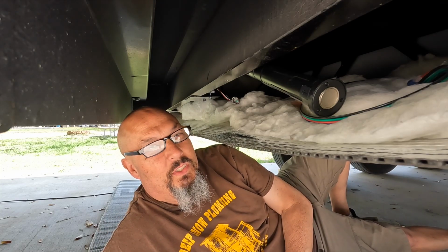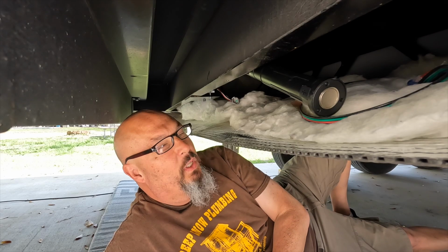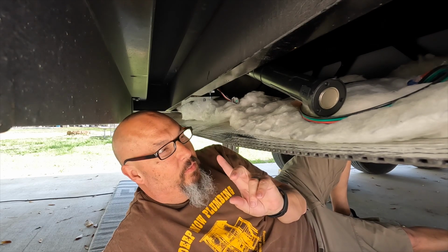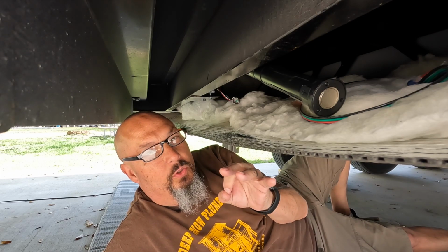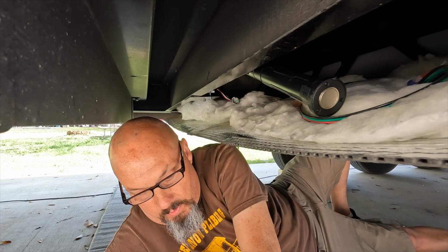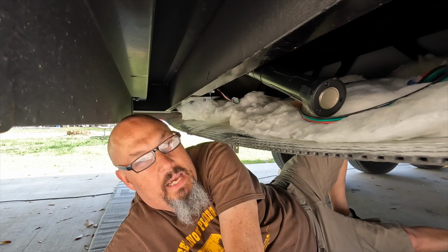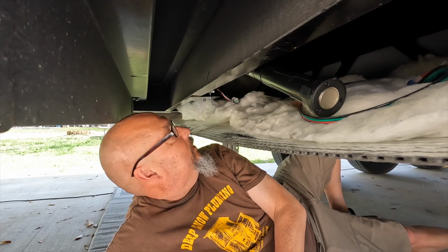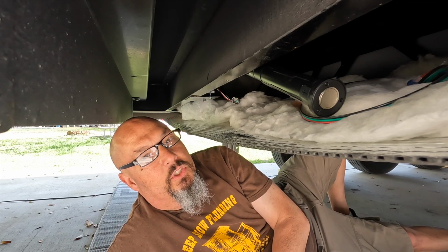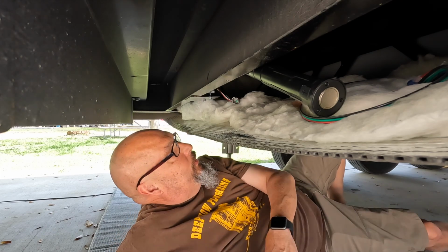Well, that was super easy, just the 2 screws. Just hold it down from the top while you screw them in. Don't over tighten, I would say, because it's just plastic. The sensor has just the plastic holes. So just line them up and run the same 2 self-tappers back up into those holes, and you've got it in place. Next thing we're going to do is go ahead and just do the connections, and then we'll take you in the house and re-zero everything and see if this auto levels.